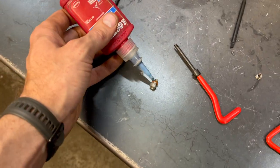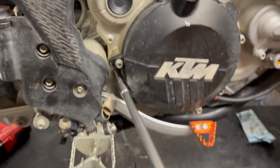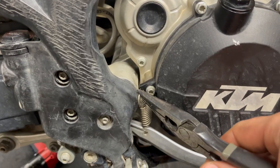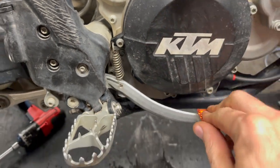I'm going to put a new washer on there - I actually have a whole new bolt the customer supplied. I'm going to put some Loctite on this bolt because it should never come out again. Lesson learned: don't use the oil check bolt. Put in your 750 or 800 mils - it's really not that picky, it's just a transmission. Put in your oil, good to go. Don't forget your brake spring, that can be a pain - just get it started like that, boom, done.